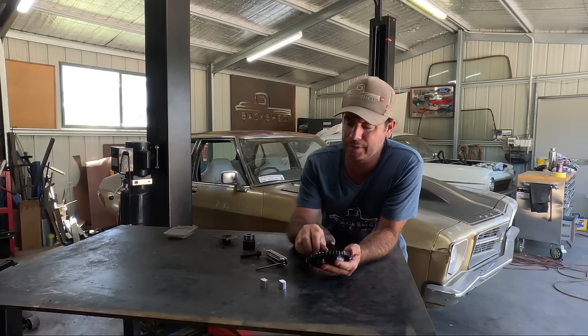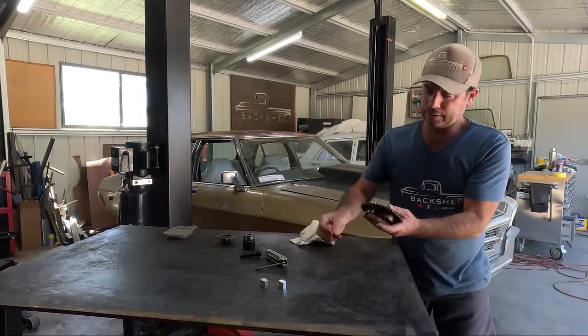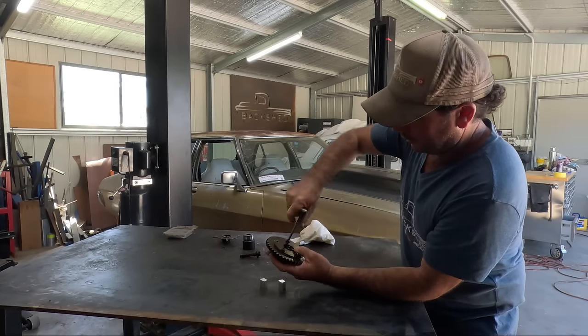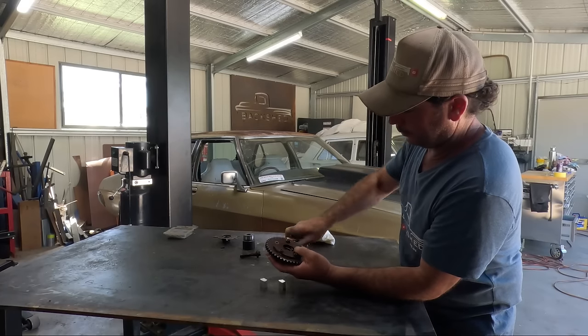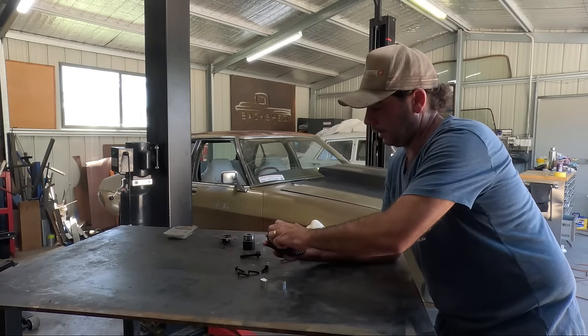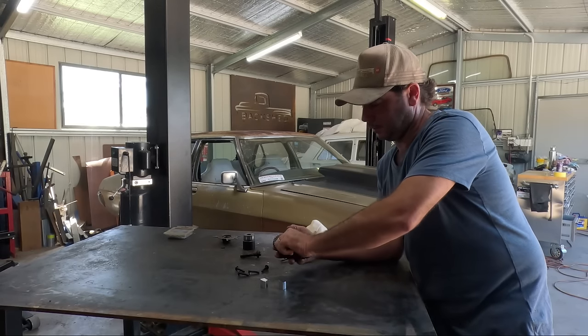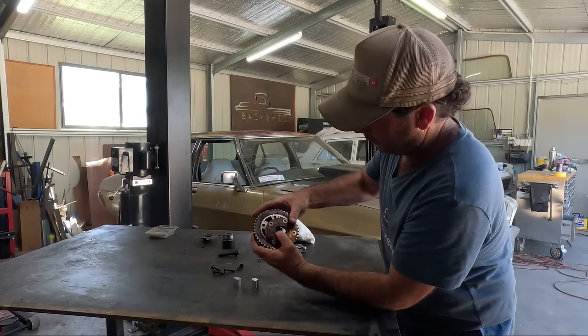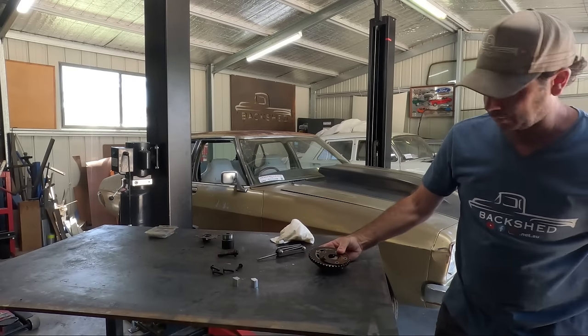Locking them out is not the issue here. I've already loosened these bolts. And this is the back of the cam phaser. And you just take four out, leave one loose, and slide the backing plate to a side. Now there is going to be a piece jump. Lock the table in, Michael, it's gonna roll away.